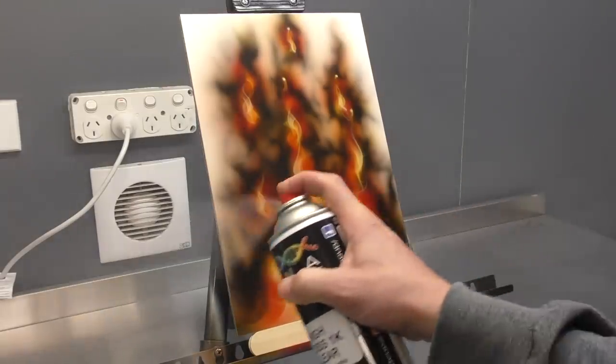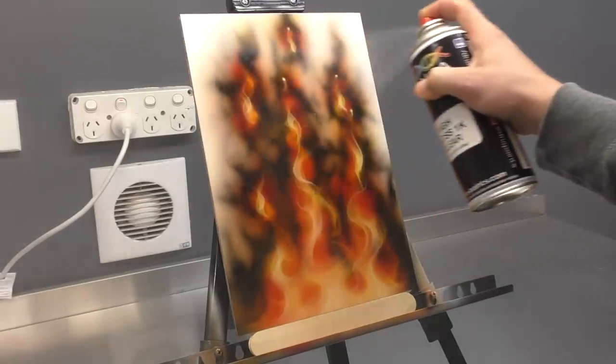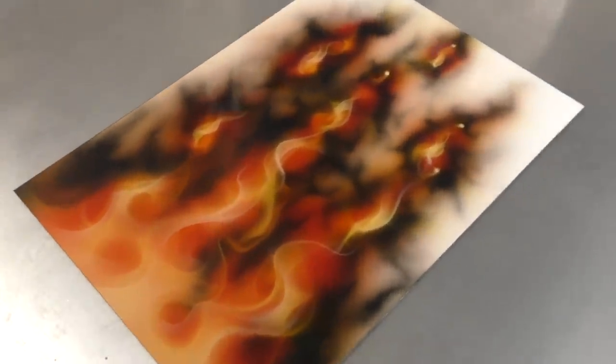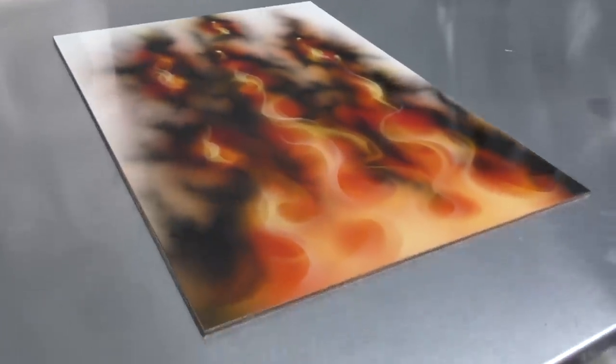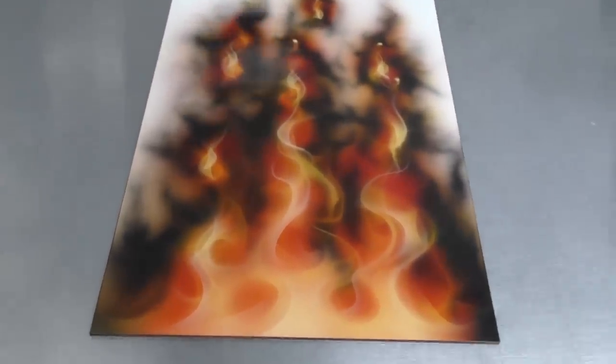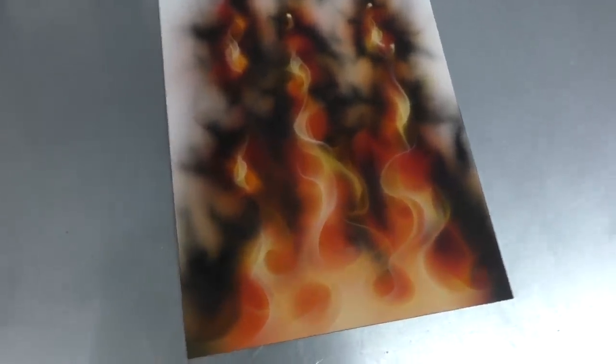It worked really well, didn't get its full gloss, but I'm going to wet sand it once it's dry and then give it another couple of coats just to bring that gloss up, because I did notice that the candies acted very much like a urethane candy would, and they did suck up a lot of these coats of clear. So as mentioned, you can definitely see here that there is a bit of a sheen to the panel now, but it's more of a satin finish rather than a full high gloss. So I'll let this totally cure and give it a wet sand and then coat it another couple of times with the aerosol, and that should seal it in very nicely and give it that high gloss.